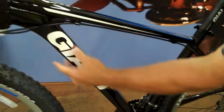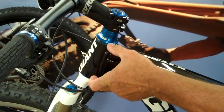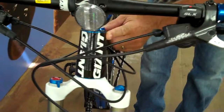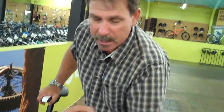You can see how we did the whole front end of this bike, which is all fluid-formed tubing. One thing you're probably noticing looking at the front end is the head tube — it's a super small head tube, but we use a lot bigger bearing on the bottom: an inch and a half on the bottom and an inch and an eighth on the top. Fox Forks is one of our partners and they made a special fork with a tapered steering tube to help strengthen the front end of this bicycle, yet keep the front end of it light.